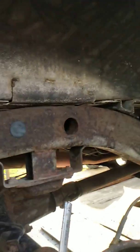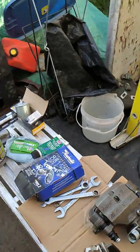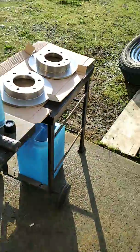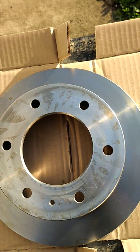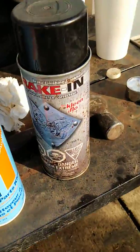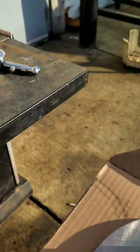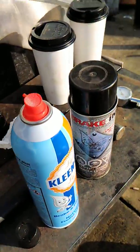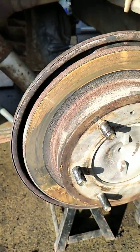She's pretty beat and it's time to swap those out because I need good brakes. I've got the new Raybestos rotors on the other side here — a nice set. I've done a little bit of cleaning; there's some schmoo on there from packing oil and I'm just going to use a little bit of Clean Flow brake cleaner to start these rotors out, basically give them a quick clean. Clean Flow cleaned up the schmoo pretty good. Here's the other side — not looking so healthy.